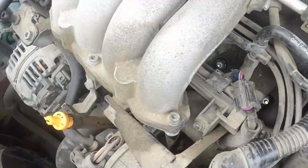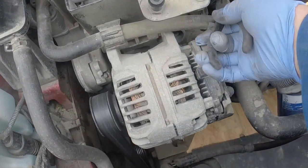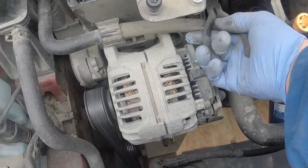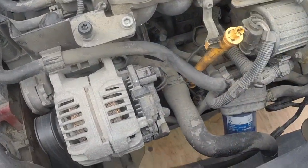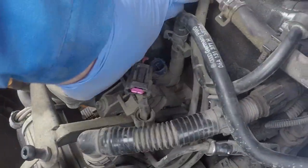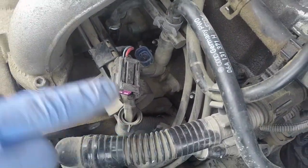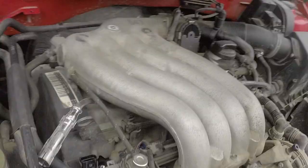Those — three and two — it's easy to reach from the bottom with needle nose pliers. Just work it out, put it straight in and then pry it up; it will come off. Set the boot to the side, then you can reach the spark plug. Number four is quite easy, as you can see.